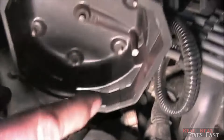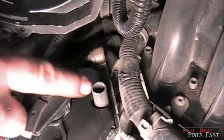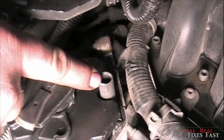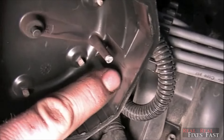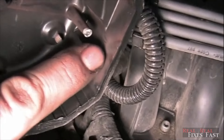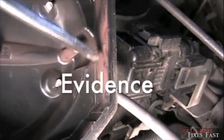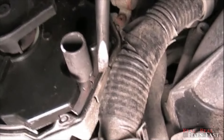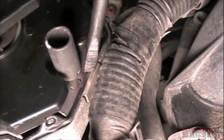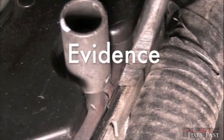If you find that coil pin and go back down to the distributor, it actually goes into this little insert down here. Now when you're looking at this coil, come over to the side and you can see some discoloration right alongside that coil stem. Let's travel that down to the distributor cap itself — along that stem, if you look at the base of that coil, you've got some cracks right in there and some discoloration there as well.